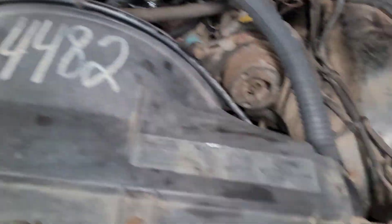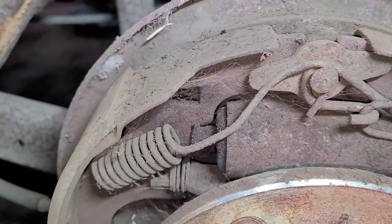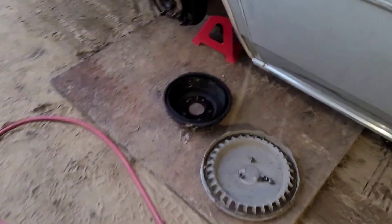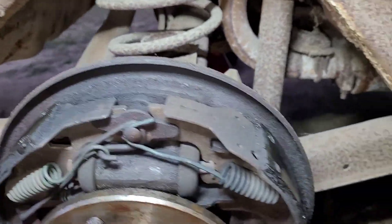I'm back on my car and I found a problem. Going to the back brakes to show y'all what's going on. Notice how everything on the driver's side looks sort of dry — no axle seal leaking, no wheel cylinder leaking. I may put a wheel cylinder on it just to be safe since I'm doing the brake. The shoes look pretty good, the drum looks pretty good. But if you go over here to the passenger side, that's where I saw an issue. Inside the drum was greasy. I see either brake fluid is leaking or the axle seal is leaking.